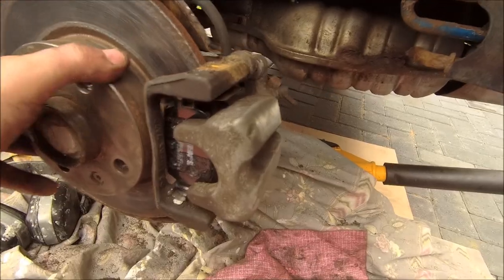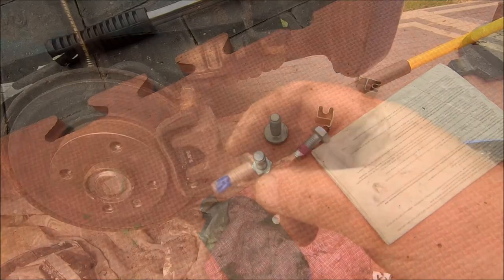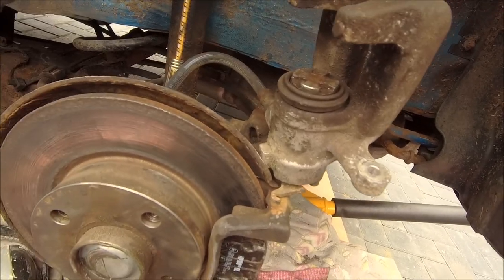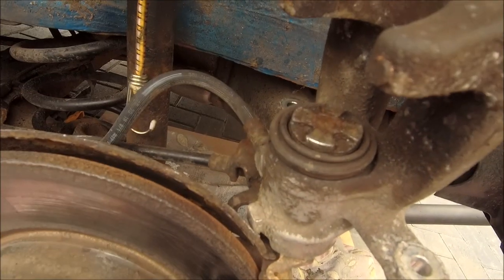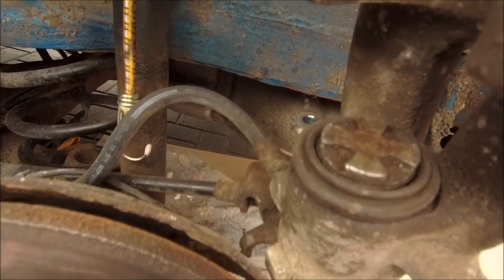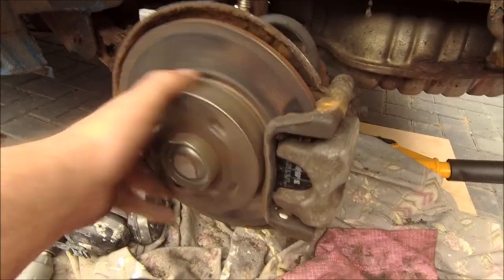Right, let's get it back together. I'm going to use some thread locker and the old bolts as well — nothing wrong with the old bolts. The new ones look really cheap and nasty to me. Bit of thread lock, twisty twisty. One thing I found out purely by accident — and I've never seen this before — when you put the brake pads in, the peg on the back has to fit into one of these slots. It kind of makes sense because it stops the pad turning and messing up the adjustment system. If it won't fit, you need to find the gap for that peg. Yeah, that caught me out a bit.